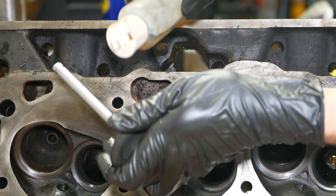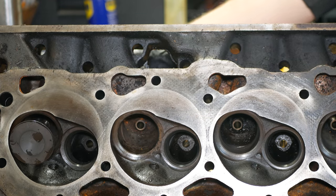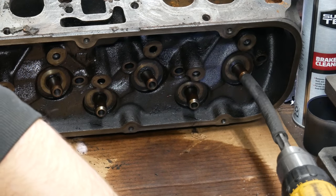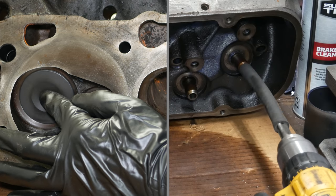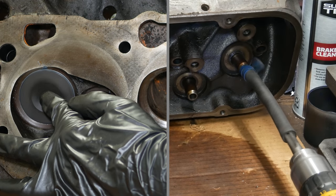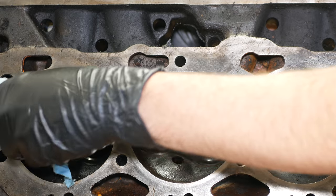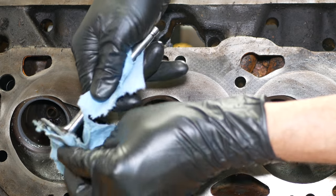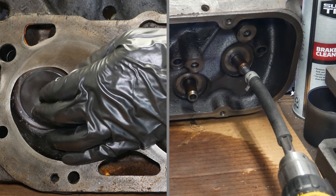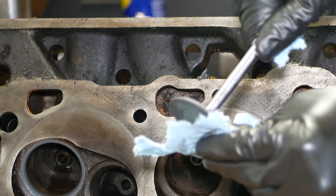Before installing each valve, we'll make sure the stem is clean and pour some 5W-30 over it. The engine oil will help it spin easily and non-destructively in the guide. Then we'll apply some valve grinding compound to its face, and with the valve pushed all the way up against its seat, we'll slip the rubber hose over the valve stem and start spinning it with the drill. What seems to work the best is a constant spinning of the valve with some inward and outward motions so that the valve grinding compound can keep moving around and grinding itself down evenly. After just a little bit of this, the abrasives in that compound have worn down and we need to apply some more. Every once in a while, we'll pop the valve out, wipe off all of the grinding compound, and see where we are. I ended up adding a clamp to the end of the rubber hose to help keep it from spinning on the valve tip, which helped a lot. And by the time we take another look, it seems like we have the valve face and seat right where we want them.